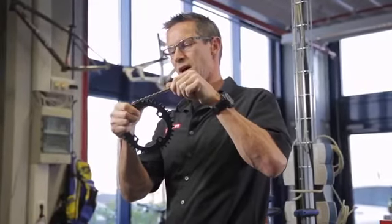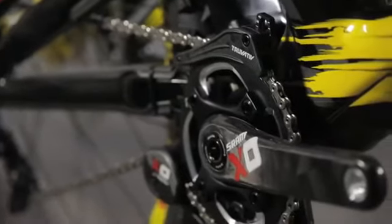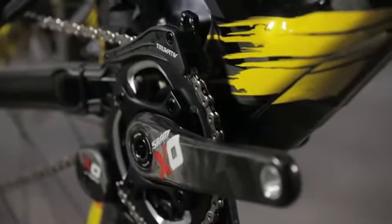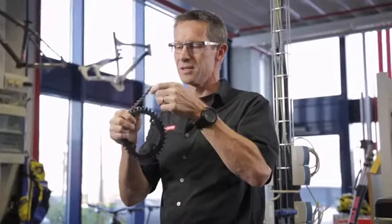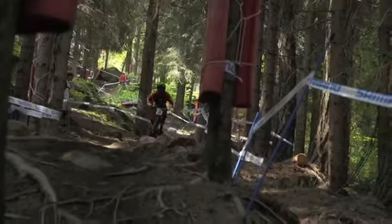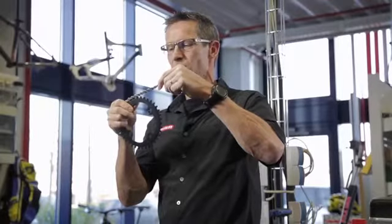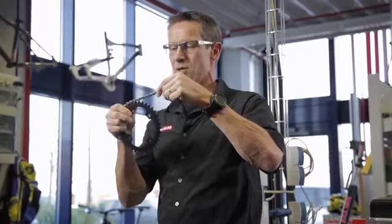So this high and pointed tip engages here at this moment. As soon as that has happened, the chain is under control. Third element are these tiny features like these rounded chamfers that make sure that the engagement happens fast and smoothly, and the sideways control is always perfect.